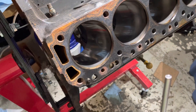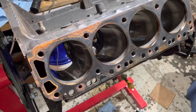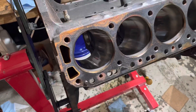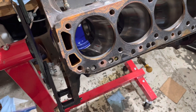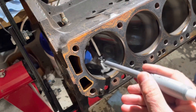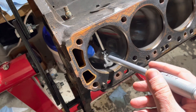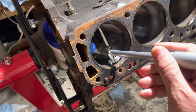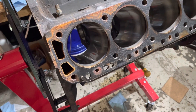That's four measurements per cylinder on four cylinders, so 16 measurements total to properly check this engine. I checked cylinder four first and it came out to about one and a half thousandths at worst — the top perpendicular, which is where most wear occurs, was one and a half thousandths over four inches.